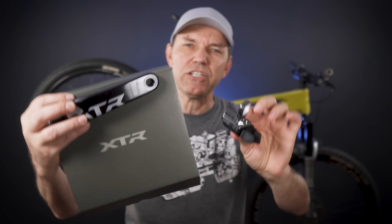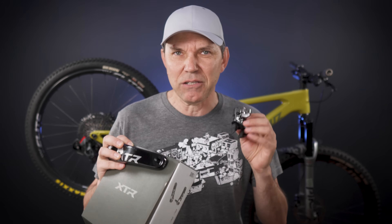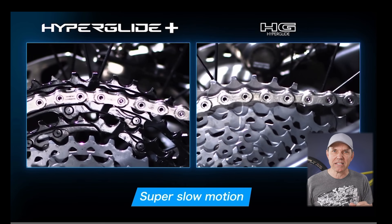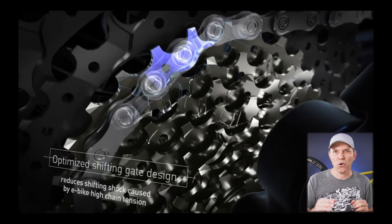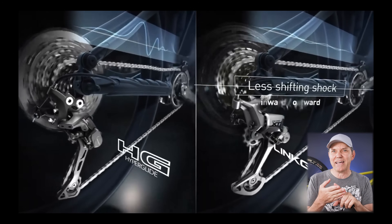There's a statement that this is a completely new drivetrain from Shimano, and I kind of refuse to say that, because the reality is drivetrains need one thing and one thing only to function, and that is the shifting technology. We've already had not one but two from Shimano in the last seven years. One is called Hyperglide Plus, which gives us low weight and fast shifting — it was built for racing. Then Shimano launched Linkglide, over the pandemic, and Linkglide takes care of the longevity of drivetrains for e-bikes. Linkglide uses thicker teeth on the cassette, lasts longer, and it's only 11-speed.